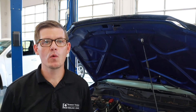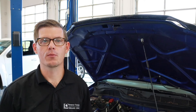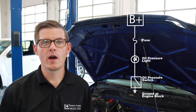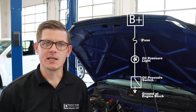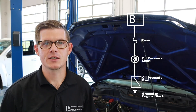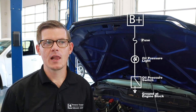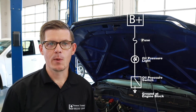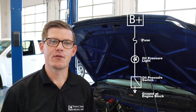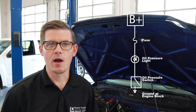Then I need to wash the engine, let it run for a while, and recheck to make sure that was indeed the engine oil leak. That follow-up check after a clean is really important to verify the repair. For troubleshooting a basic warning light like this oil pressure light, the system is made up of the oil pressure switch, some wiring, the dash cluster, and the light bulb. On this car it's a basic circuit — one wire goes to the switch and it uses the engine block as a ground path. During key-on bulb check, I need a good ground path through that switch. If I don't get that, I know there are things to look at in terms of power availability and the ground path.